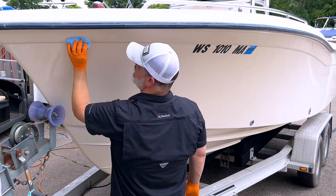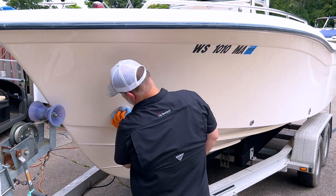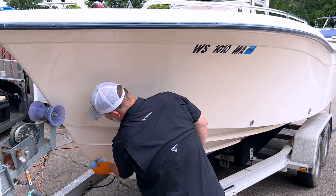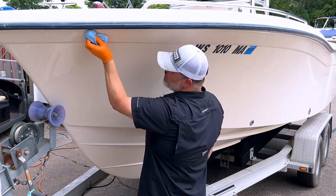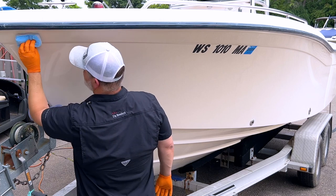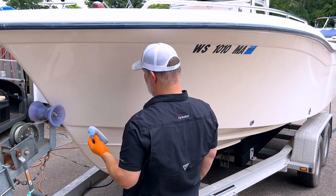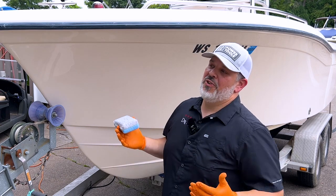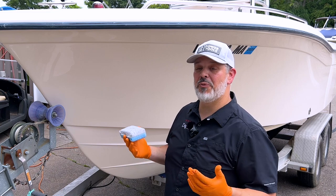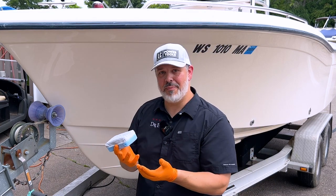It is an instant bonding coating, so it'll start to be effective as soon as we put it to the substrate. However, like any of our other coatings, we're going to want to follow the same guidelines of 1 hour undisturbed, 24 to 48 hours dry, and 2 weeks no washing. Of course, that usually has to do more with automotive in mind. It's always hard to judge, 2 weeks no washing, okay, not hard on a boat, but really the idea is like the loaf of bread is just not fully baked.